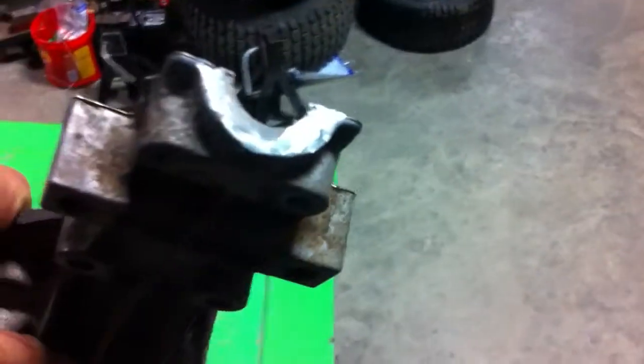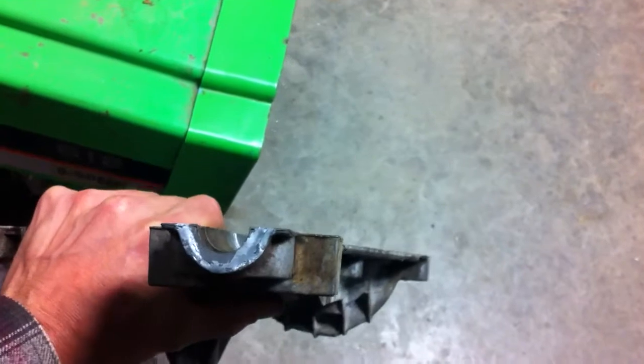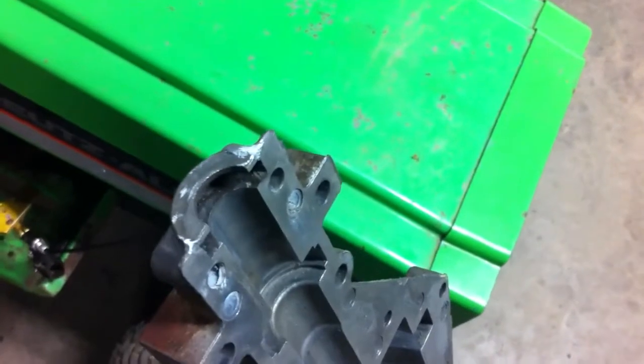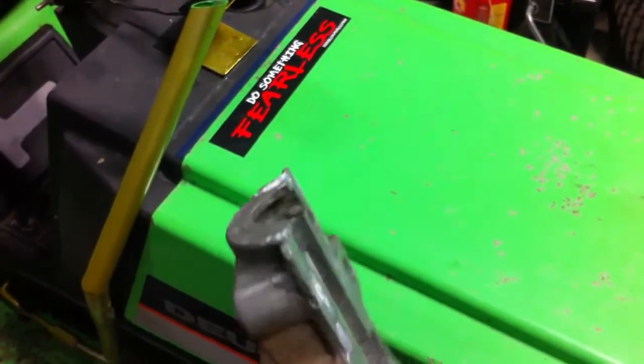I finished the aluminum welding trick — let me grab this thing so I can get it in the light a little better. You can see that whole piece on the end there was just about cracked all the way around. When I bent it back, I knew it was going to crack more. The edge of that is a little rough and I ended up welding the corner on it and just filing it down flat. It's fair — I've got a little more work to do to it, but I think I can do it when it's assembled.